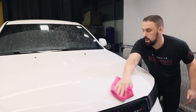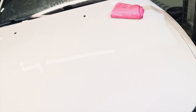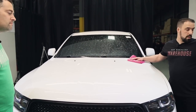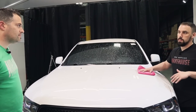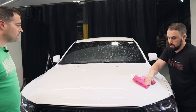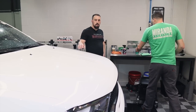Working a large area, you can see a little bit of residue — it's super slick already. After further testing, the best thing is to leave it, carry on with the rest of the vehicle, then come back with a damp towel method, similar to how you'd do a water-soluble ceramic coat removal. You can do it in your drying phase then buff off the residues, or lay more product down for more even protection. Come back with a water spray to address any streaking. Give it 6 to 12 hours for peak performance.